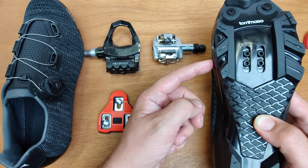You can also adjust tension on the SPD system — there's a plus and minus sign here. Plus is more tension, minus is less tension. You're going to want to play around with SPDs. My preferred tension: turn it all the way out until the bolt won't turn anymore — there are little clicks as you turn it — loosen it all the way up and then go in three clicks. You'll feel the bolt have these kind of notches in it. That's where I like to start folks when they're first getting started: all the way out and then three clicks in. If you do the tension all the way loose, a lot of times you can just pull right out, and that's too much.